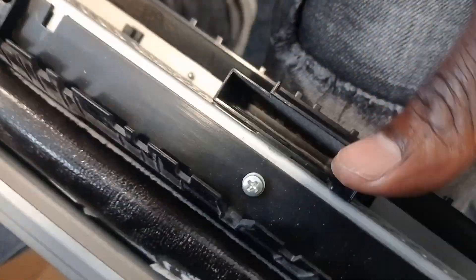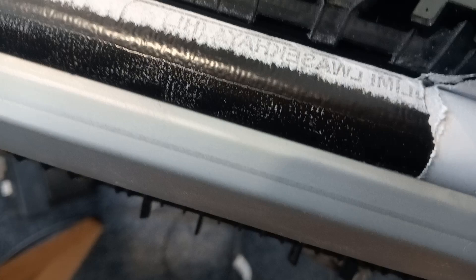This paper — I'm rolling to remove it. A lot of papers got mixed up here, rolled on the fuser. Please guys, put clean paper in your machine. You can see now the fuser itself. This is where the fuser has to be — the fuser sleeve. But now there's a bunch of papers which are rolled on here. I should roll this to clean the fuser out of these papers. Once I do that, I'll manage to make my machine print again.